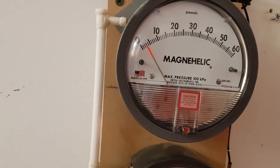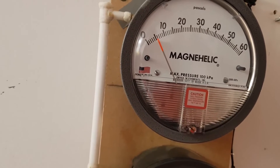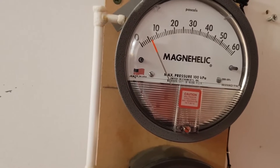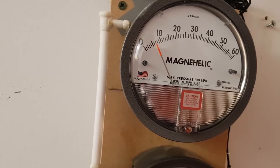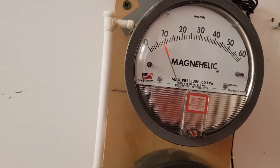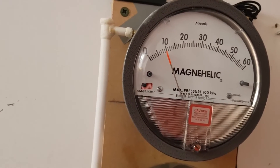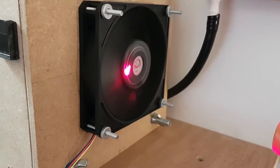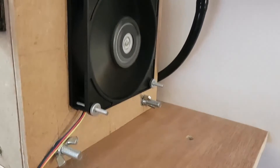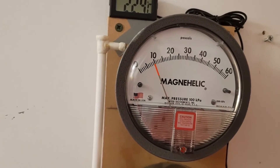If I nudge the speed up, the static pressure will rise, as will the airflow. And this is why it's silly to talk about fans in terms of being either airflow fans or static pressure fans, because they do both — especially in a PC cooling environment, they will do both at exactly the same time. The level of static pressure here — let's nudge it up to about 10 Pascals. We're almost at 2000 RPM. Not many people are going to want to run a fan at 2000 RPM because of the noise, and therefore the level of static pressure you're getting from the fan is moot.